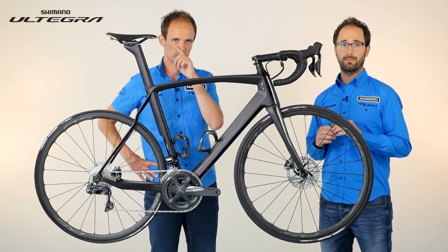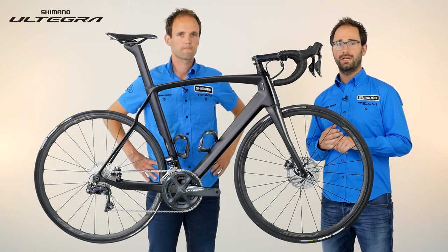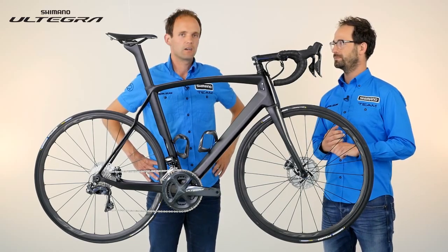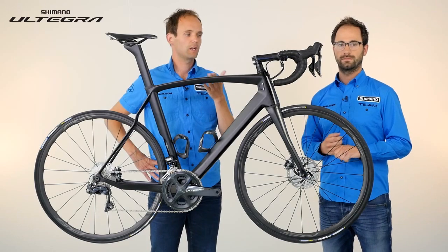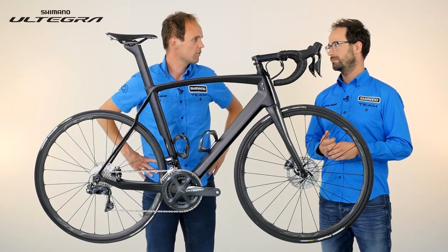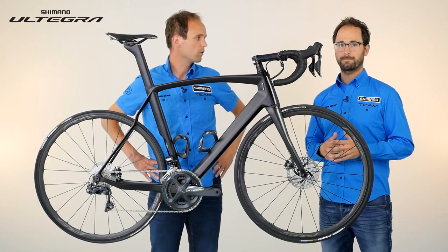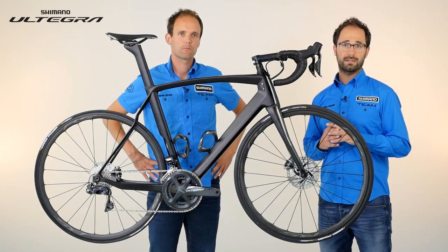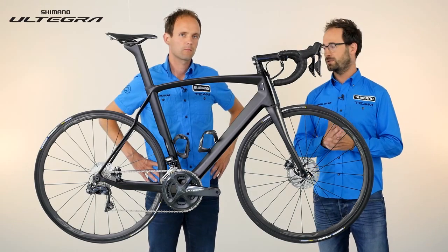Yeah. Question coming in from Gino. Gino has Campagnolo wheels, and he basically wants to know, can I fit my 12-29 cassette with this group set? That of course depends on whether your wheel is 11-speed ready. 12-28 is a cassette that is within the range of the short cage derailleur. So that's within the limits and should be possible, but we cannot guarantee it will shift perfectly because we haven't tested on Campagnolo cassettes also.